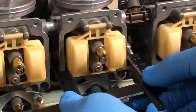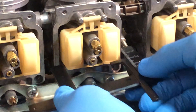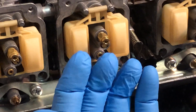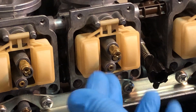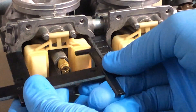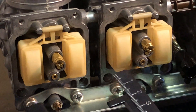When I get here — this is an aftermarket float needle — look what happens. The float is actually being deflected, which means that it is sitting lower, with the carb being right side up. The float level is actually lower on this particular carb. Let's check this one. Okay, so this float doesn't move, and the gap is essentially the same as it was on the OEM carbs.